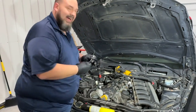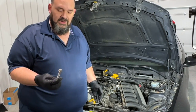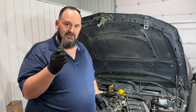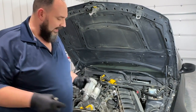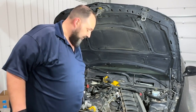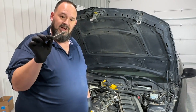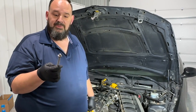The point of this video is not to teach you how to install a starter — there are lots of great videos for that, and I'll try to link one below. This is to teach you how to get this stupid bolt out if you manage to bugger up the threads like we did. Our trick with JB Weld, heat, and penetrating fluid got this thing out before we had to get destructive. Worst case, you could drill it out, or use an oscillating tool to cut it off where it butts up against the transmission — but be very careful not to damage the transmission. Try the JB Weld method first.